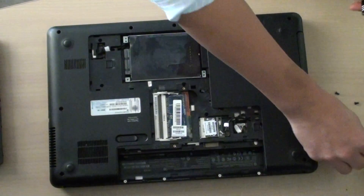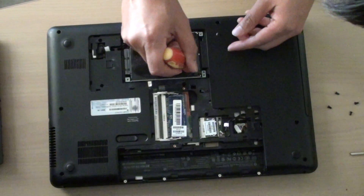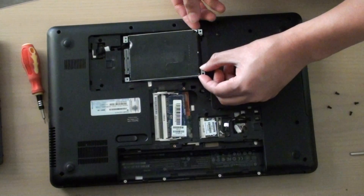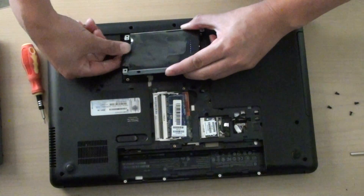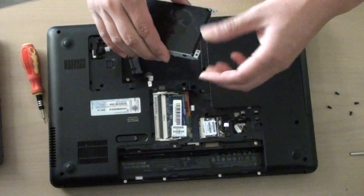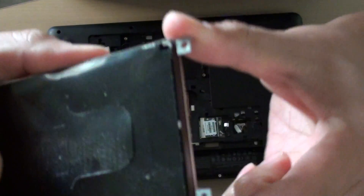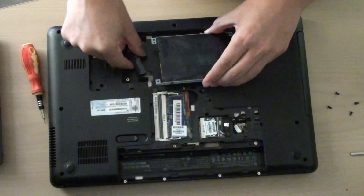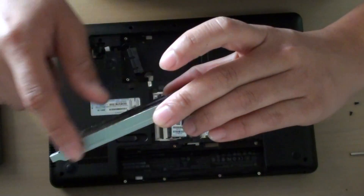There is a small hole, you need to pull up the hard drive a little bit on this side, and then we need to pull out this clip here. There's a small hole right here, so that's why we need to lift up the hard drive and then pull it out, and then we need to detach it from the main cable — the hard drive cable.